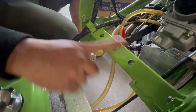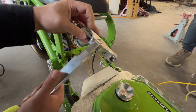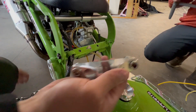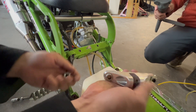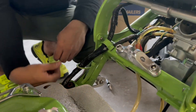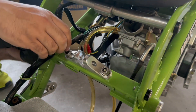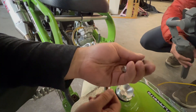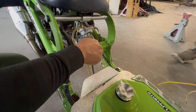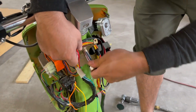So that's as flush as it's going to get without doing any more carnage. We're going to grab this guy, take it apart, separate the two, take your hardware off — hopefully that's self-explanatory. Now you need a bigger hammer. Once you kind of have that mocked into place, run these all the way down. Get your two 17-millimeter nylocks and put those on the back. Don't snug everything up yet, just leave it as is. We're going to pull that 10-millimeter bolt out.